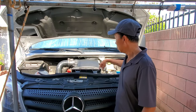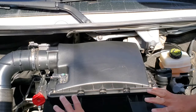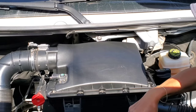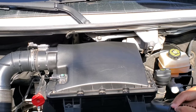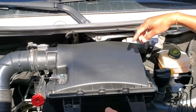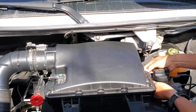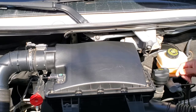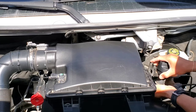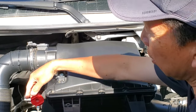This whole unit here is not screwed to anything — it's like a spider, it clamps through the back and then snaps into these two holes right here. You can just pop it up, and then disconnect the air intake right here — just push it and it'll pop up. Take that out. On this older model, the oil filter cap is attached here; there's a tab underneath — push it in and pop it out like that.